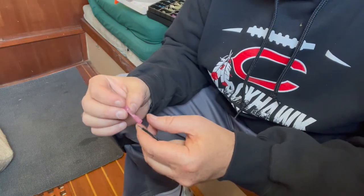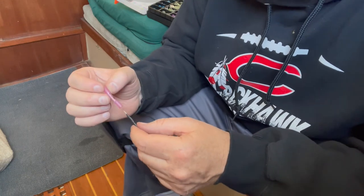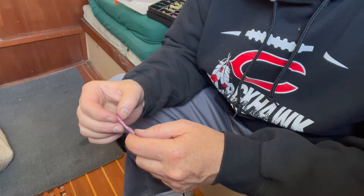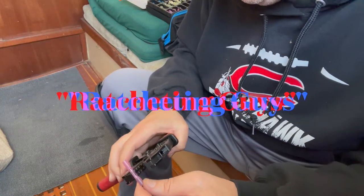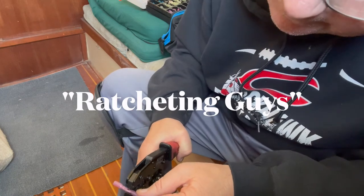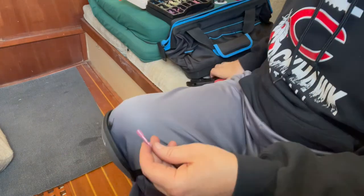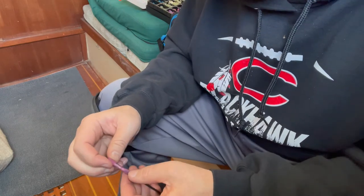Pink is what we want — it's 22 to 18, and this is an 18-gauge wire I'm using for this sensor. I'll go in like that and just clamp it down. I love these ratcheting crimpers — these things are the bomb. There we go; you get the right amount of pressure every time. Pull test — good.